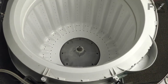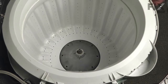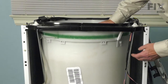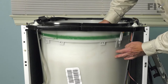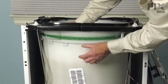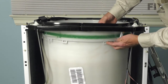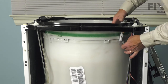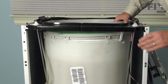Now, with those tucked out of the way, we'll next need to remove that tub cover. It's held to the outer tub with little tabs all the way around the perimeter. To remove that outer tub cover, we need to release these tabs that go all the way around the top of the tub. Simply just press down a little bit on that tub cover or lift out on the tab to clear that little tab on the outer tub and then lift it off. Just go all the way around until you've released all of them and then we can lift the tub cover completely off the tub.